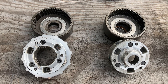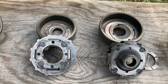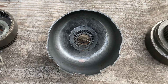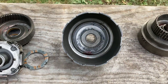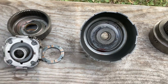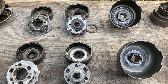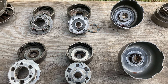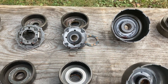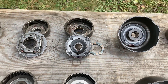Lightweight and low drag and maybe upgrade the rear gear later, or make that thing really have some good 60-foot times with the 4.10 gear. Here's the corresponding sun gear that goes with that set. The 2.45 close-ratio gears have that small sun gear, and then you have the larger sun gear with the wide-ratio set. A legitimate pro and con could simply be: which do you have? I have a couple sets of each, so it's just a matter of deciding which to use. These were standard from 1981 and up; they quit using the standard ratios, and these became the standard ratios.